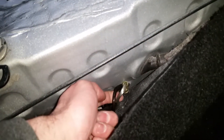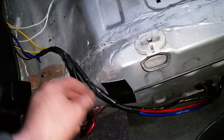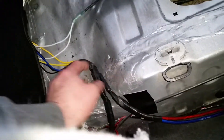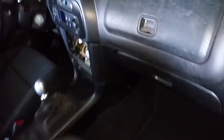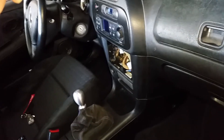For now it's just a single 255 with the fuel pump rewire, and I drilled a hole for ground right here so the pumps are grounded there. I need to clean it up a little bit more but it's more or less wired now, which is good. Most of the interior is put back together. I sold my head unit and I'll be getting another one later, but right now I need that cash to do some work on the engine — there's no point in having a nice stereo in a car that doesn't run.